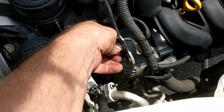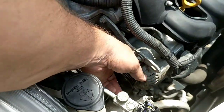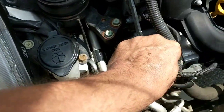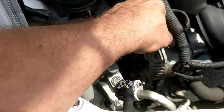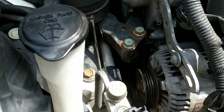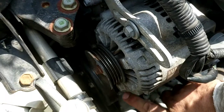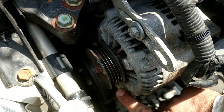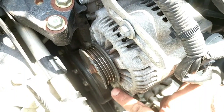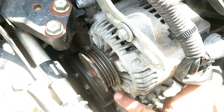So there's the engine — this looks like the alternator, I'm pretty sure that's what it is. I loosened this bolt and you see how there's like an upside-down smiley face? That's because this slides forward and back, and that's how you tension the serpentine belt. Down here is a 15 millimeter bolt — there are two smaller ones below it, but it's the bigger one you want.